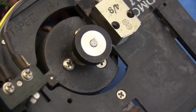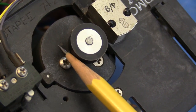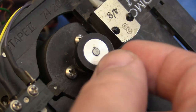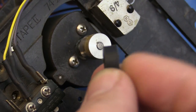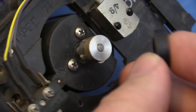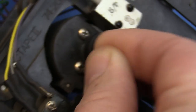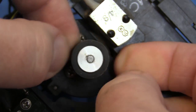These transports also have a very common failure mode, but at least it's easy to fix. This rubber tire on the capstan, after 30-plus years, decomposes and then either turns to sticky goo or just crumbles away. I've already replaced this one with a piece of latex tubing — the same type used in wrist rockets, just black instead of yellow. It's very soft and grabby rubber. After cleaning off the goo from the aluminum hub of the capstan, I cut it to length and just press it into place. It stays there by friction; I don't think it's going to require any glue.